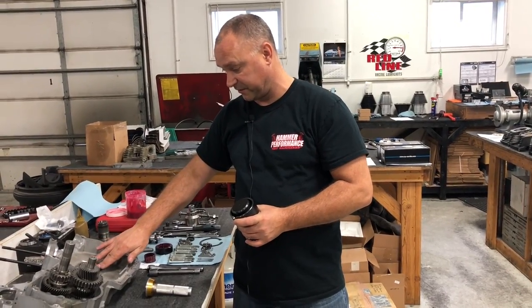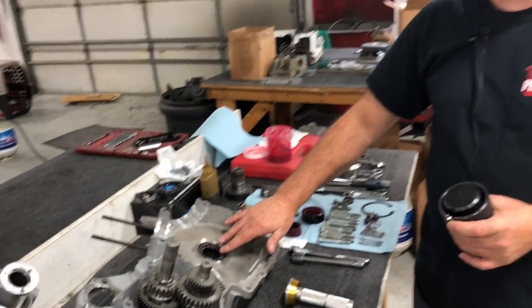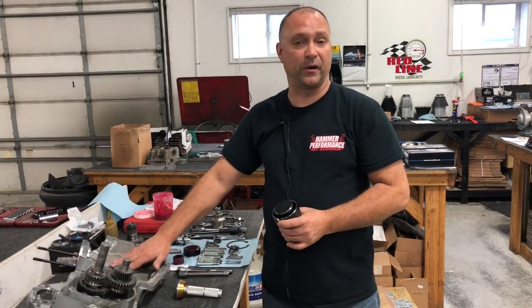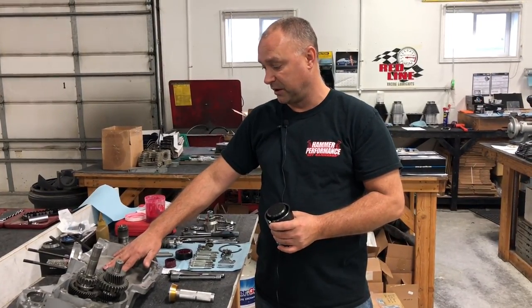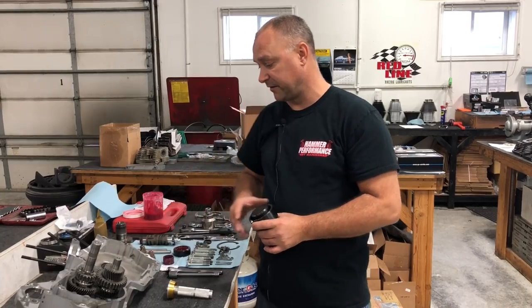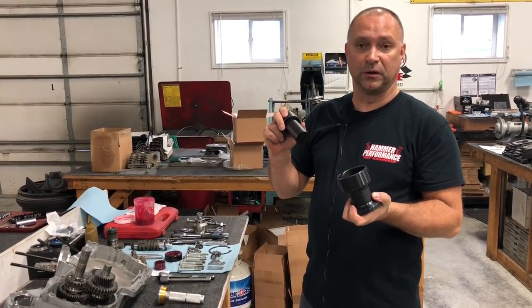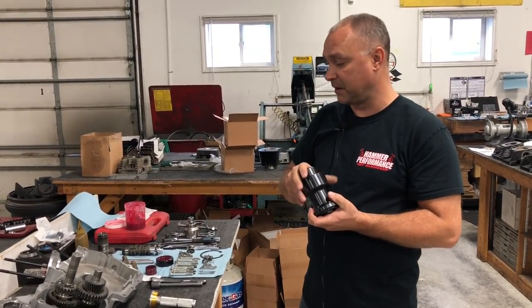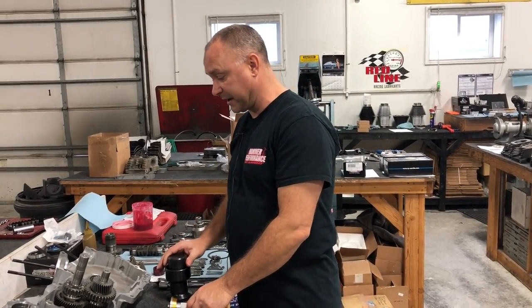Motor sprocket shaft bearing is the same as the twin cam bearings on either side of the twin cam in a set of twin cam cases. So they consolidated bearings with the twin cams and the later model rubber mount Sportsters on that drive bearing on the left hand side there. So we use a twin cam tool, bearing tool, to press this bearing in. But you cannot use this tool to press that bearing out.